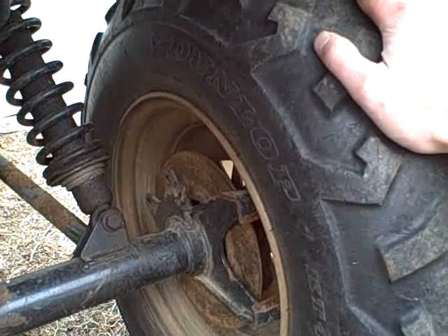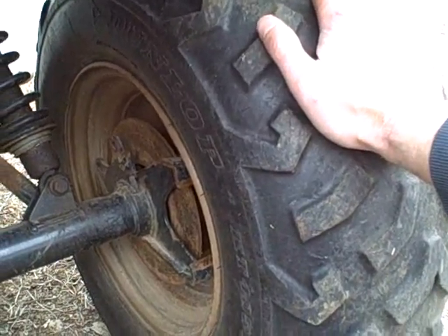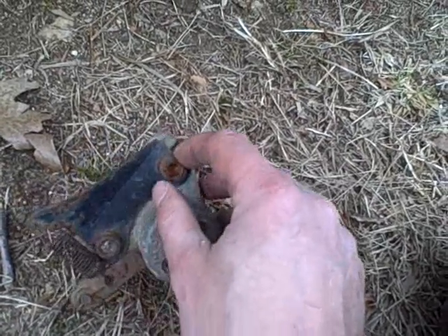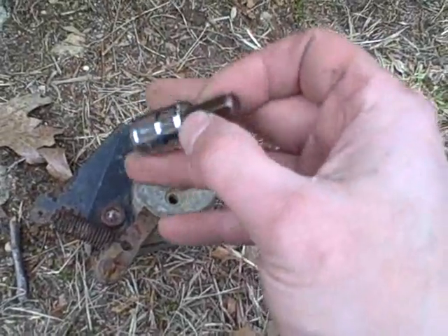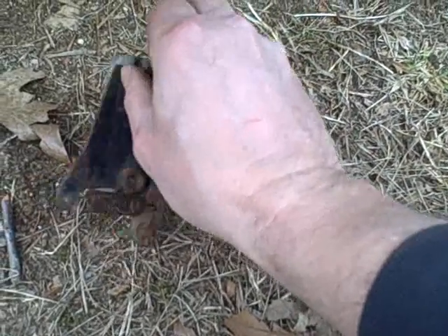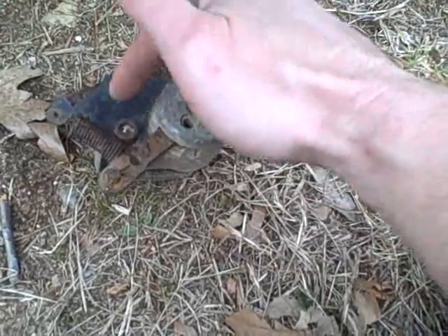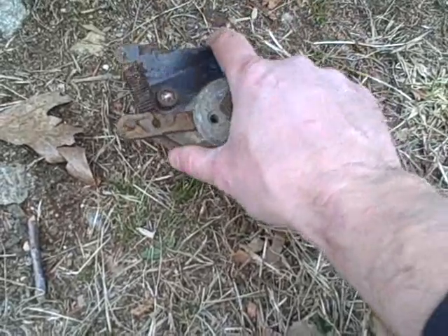So today I'm going to put the mechanical brake assembly with the new pads back on, along with a new cable. The first step to make life very easy is to remove the rear wheel. Next step is to remove these two eight millimeter hex head internal hex head cap screws. If you don't have an eight millimeter drive like this one, you can get by with an allen wrench if they're not too seized up. Removing these two bolts allows the caliper to come apart into two halves, which makes it really easy to install the new pad.